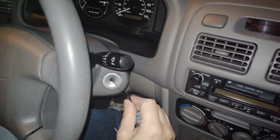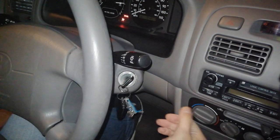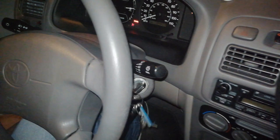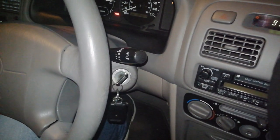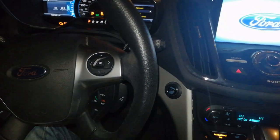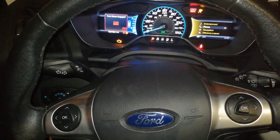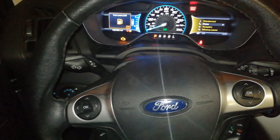Start the booster vehicle and press the accelerator pedal moderately. Start the disabled vehicle. Check the instrument cluster for the ready-to-drive light, as the gasoline engine may not start, but the electric motor may be running.